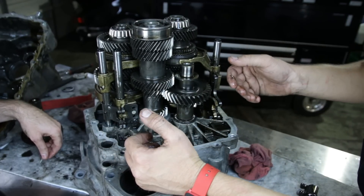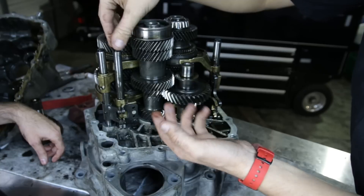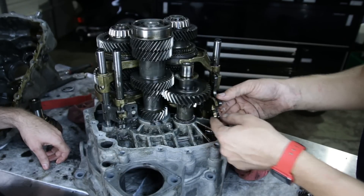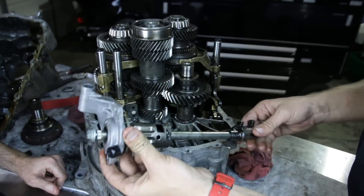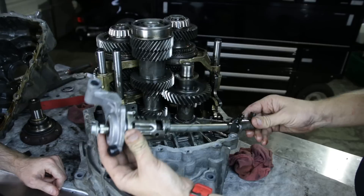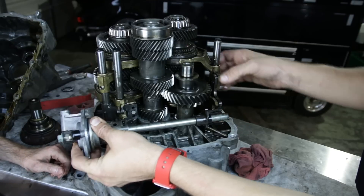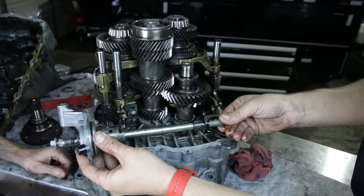When you're moving your shifter in your car forwards and backwards, you're moving one of these shift forks up and down. When you're moving your shifter left to right, there's a little pawl that's deciding which one of these you're moving. This is our shift console — or tower, as some people call it — for our O2 series transmissions. The shift lever bolts on here and goes out to the cables. When you move the shifter forwards and backwards, you're rotating this shaft, and the pawls lift the fork up or down depending on which way you rotate it. When you move the shifter left to right, it moves this in and out.